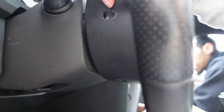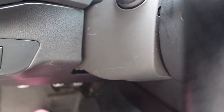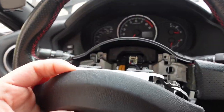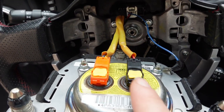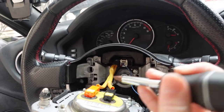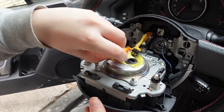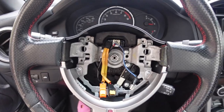In order to remove this part right here, you have a little hole on this side, on the other side, and one on the bottom. You're just gonna click those little things and then this should just come off. Be careful — you still have wires attached to it. This is your horn wire, and these two are your airbag wires. You definitely want to unplug your battery before you unplug these — that's really important.